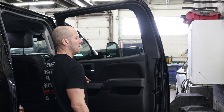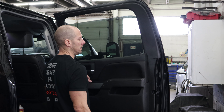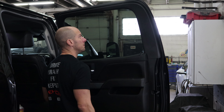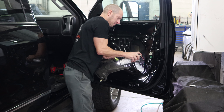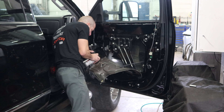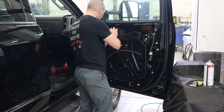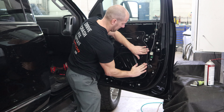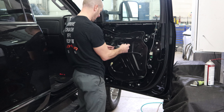While we're here we're going to put our cavity wax in, put our water barrier back up, grab handle bracket back on, put our speaker back in, plug in the switches on the door panels, plug in the door handle, clip our door panel in, put our screws back in, put our covers back on. Now we're going to check our window — apparently the last guy didn't. This is all it takes: check your work, even if you've done it a million times. We all make mistakes.